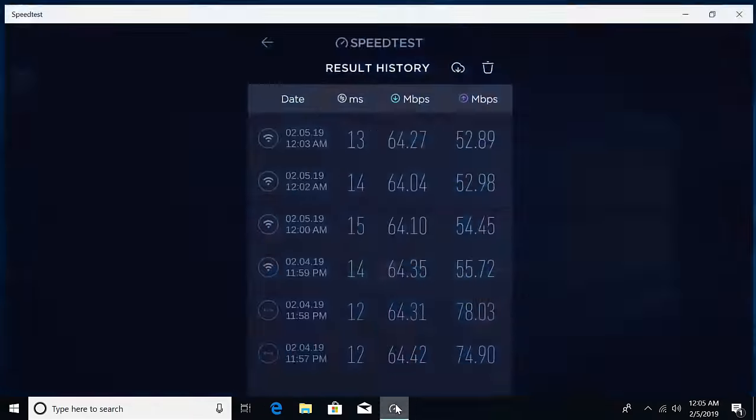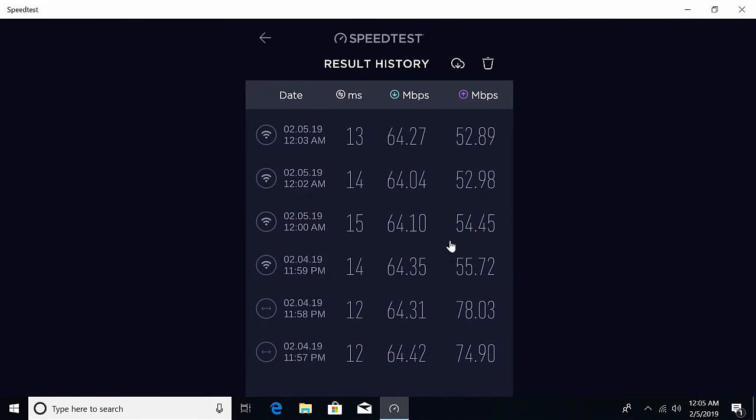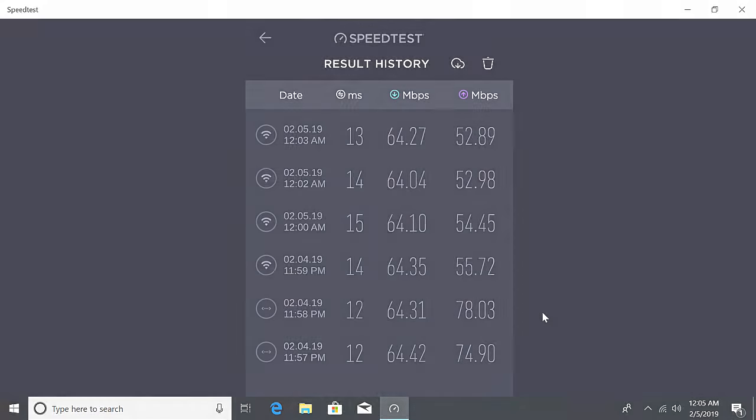Next, I have the results of the Wi-Fi and Ethernet LAN speed results. On my 60 megabits internet package, the U500 was able to hit the maximum speed with every attempt on the 2.4, 5 GHz and Ethernet LAN port. Also take note of the upload speeds I got during this test, they are twice as high compared to what I would usually get on an Android box.